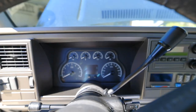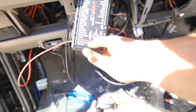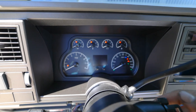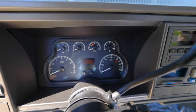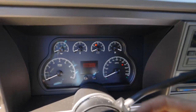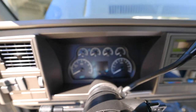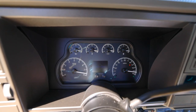I have no idea what just happened, but I checked my constant 12-volt, ignition, and ground and it was all good. I turned the key on again and it didn't do anything, and then I just turned the key on and this happened. We have a low voltage warning on our battery. I put a battery tender on there — let's look at this again. Turn the ignition on — it's still low.